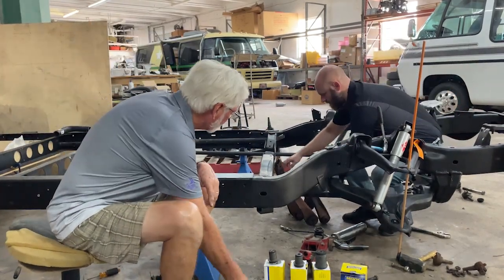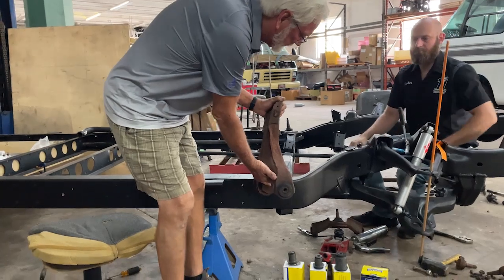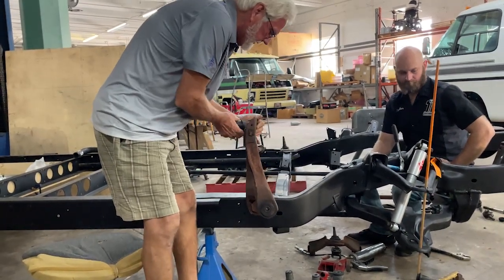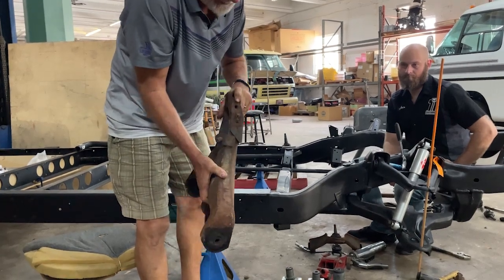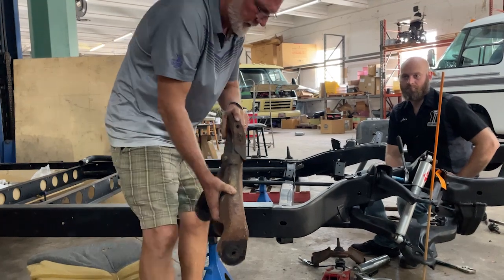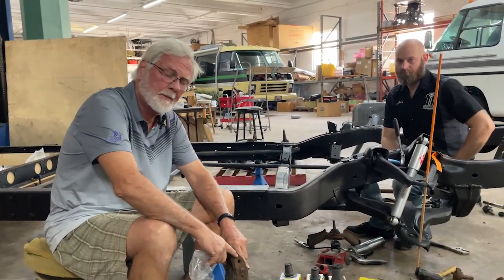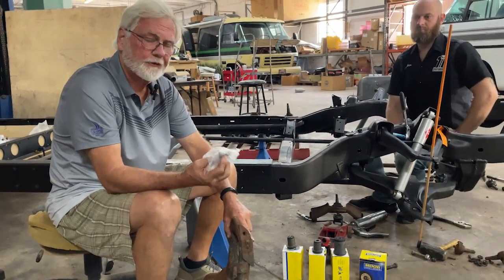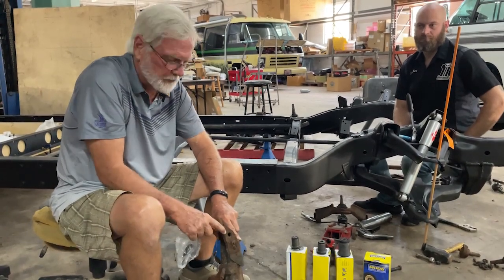This is a lower A-arm with 35 years of patina on it — it's fine. This is the hole for the ball joint. Over the years, the hole has become oblong because that bolt has moved. If you have this situation, the supplied bolts will be too small for that slot. You want to get a 10-millimeter bolt, re-drill that hole, and put a bolt that fits the hole now. Then when you put it in, destroy the threads — take a punch and punch the threads after the bolt is tight, so it will not back out.